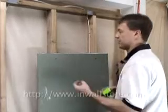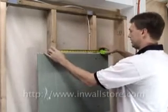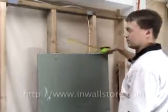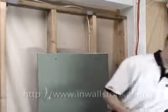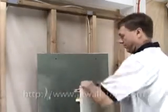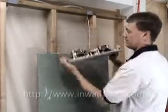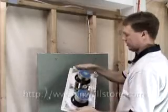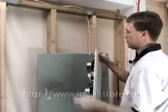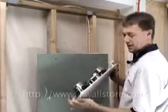First, you'll look at your walls and you'll notice you're 16 inches on center. At least close enough. I'm not a framer. So anyway, we've got that, but then we pull up the mounting for this guy, and you can see you're not 16 inches on center. And these have little dog ears on all four corners that need to clip in to the drywall and mount this guy flat.